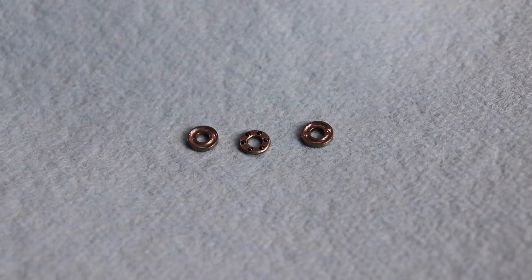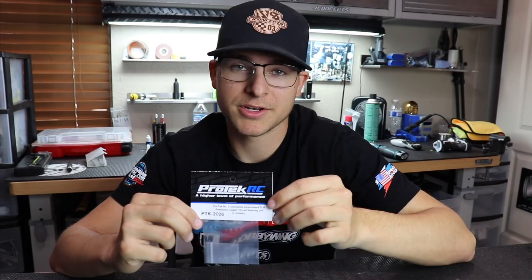Some of the key features I use in the diff that I'm going to talk about before we start building: the greases and the Pro-Tec cage thrusts. This is something I've been using for about a year and a half now. I'll link a part number down below in the description. This has really helped with the longevity of the diff, how smooth the diff stays, and it's just so easy to build — you don't have to put individual balls on the ring and lose them. It's pretty inexpensive, especially for how important the diff is in the car. It lasts longer and it's easy to build. Definitely check out the cage thrust.